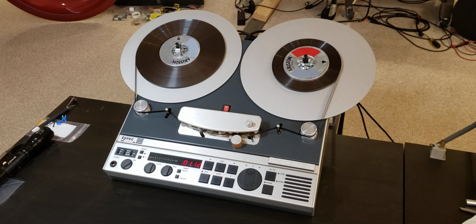They are wide track heads, which I'm not crazy about, because they have very narrow guard gap. But at the same time, they are of very good quality. They look like they could be Sony heads to me, based on their labels and wiring attachment. Maybe they are Sony, I don't know for sure. As you can see here, the quality of finish is simply superb everywhere on this machine.